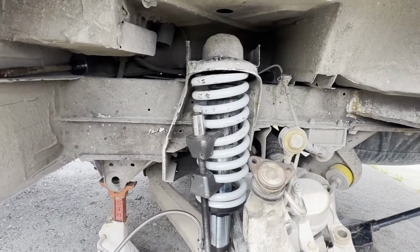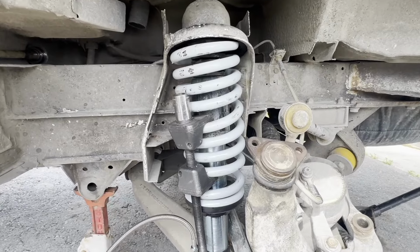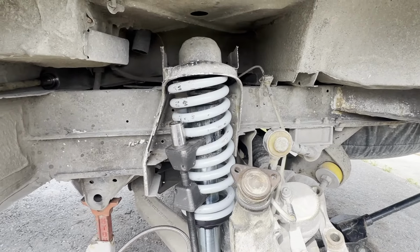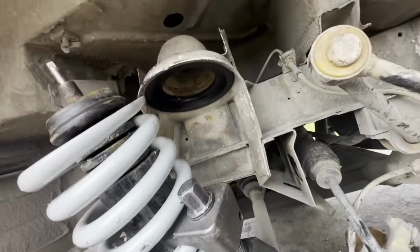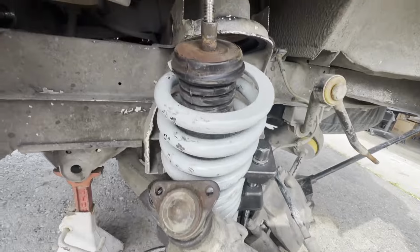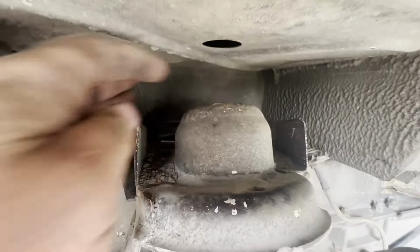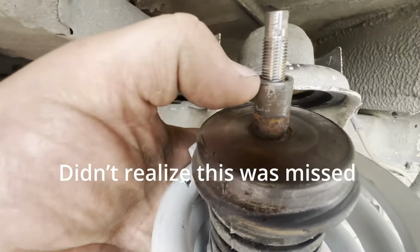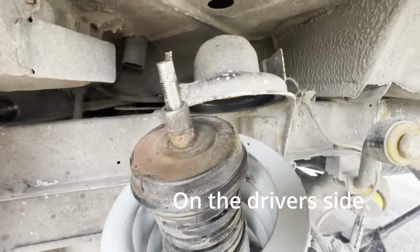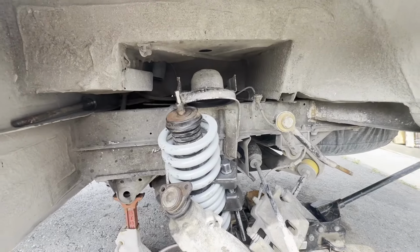This side was going together way easier and we screwed up. So we figured we'd wait until this morning to start over from last night. We are back to reset. Now we'll get everything up inside there like it's supposed to. Problem we were having was this sleeve was hitting on the hole up here in the top of the shock tower, and it wasn't allowing it to drop down in there because it was hanging on this lip. So now that we've got it completely reset, we'll slide it up into the top first, and we'll worry about down there in a little while. We'll see if that makes this a little easier because it's plenty abusive already.